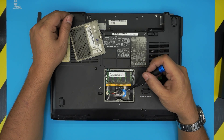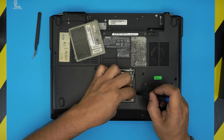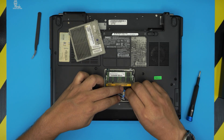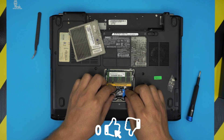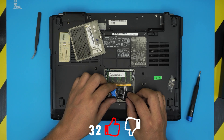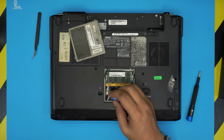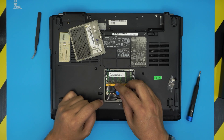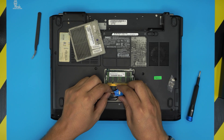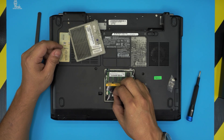The C-lock is on the other side, which prevents it from coming out. The CMOS battery is right in front of you — it has a little old tape on it, so rip off that tape. The reason you'd want to replace the CMOS battery is it will not hold the date and time. These are simply a CR2032 — yeah, a CR2032 — with soldered cables to the positive and negative. The white cable is ground.